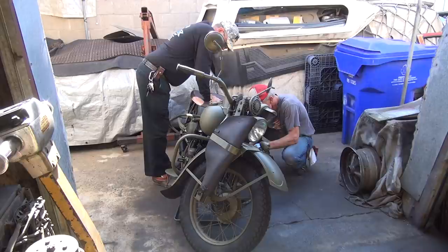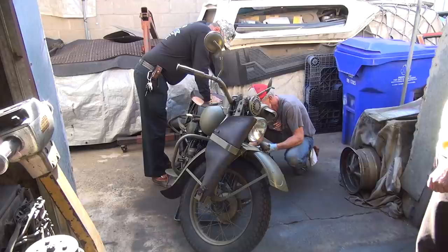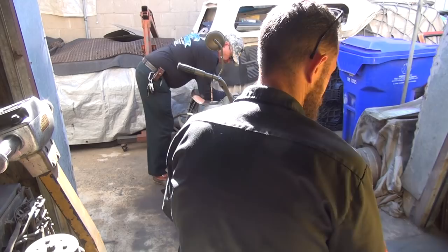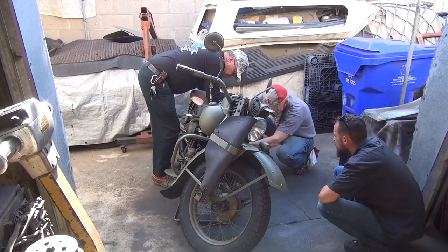I've got some crazy noise coming out of my bike, I'm not sure. Still, the motor sounds good. Push rods are adjusted well, that's a good sign. Sounds like, when I leaned it out, it kind of went away. I think maybe there's too much dripping. It's dripping gas out of the carb. Good. And this bowl is wet. So it's flooded.